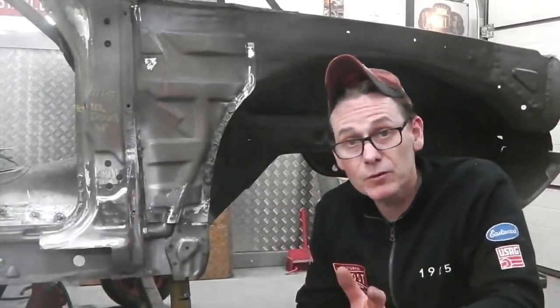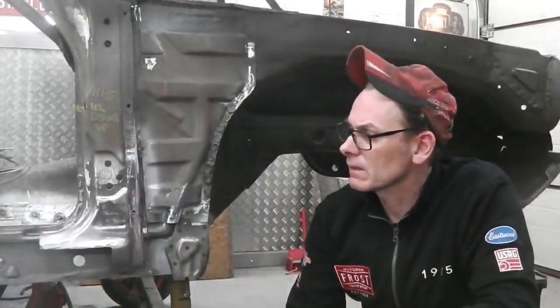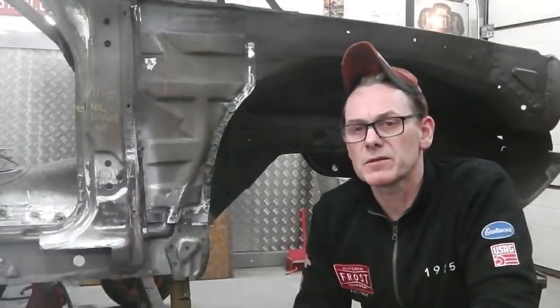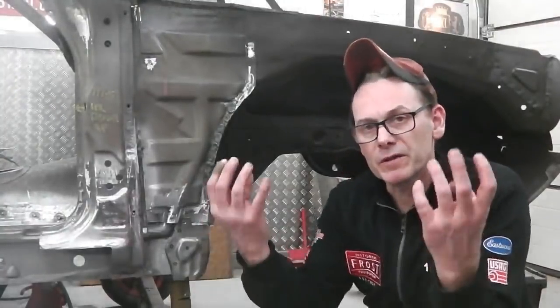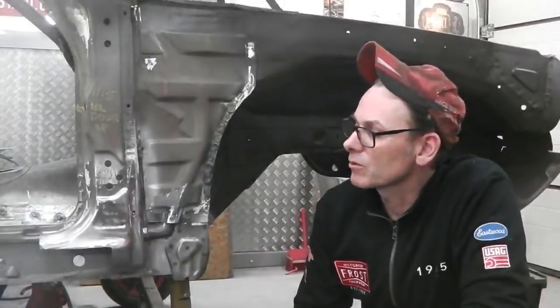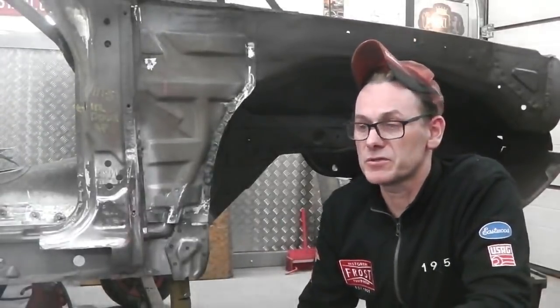We might have to get a floor frame off one of the seats and mock it up and make sure, because we don't want to get that wrong. We've got to make sure that when you come to assemble your seat and bolt it into the car, that you not only fit the captive nuts, but got them in the right spacing. Wouldn't be anything worse than that, you'd be stuck.